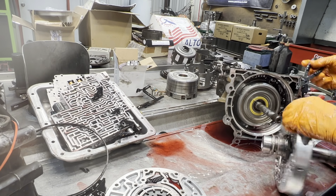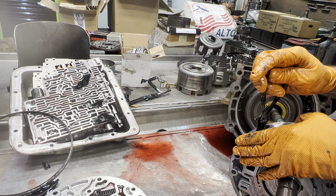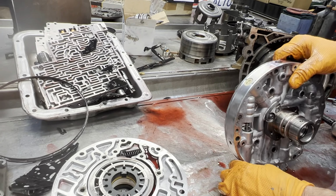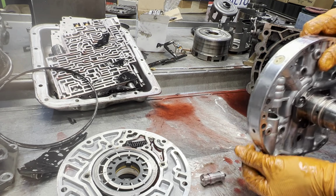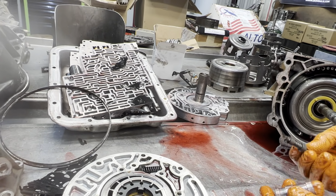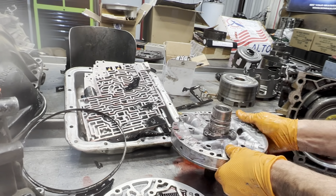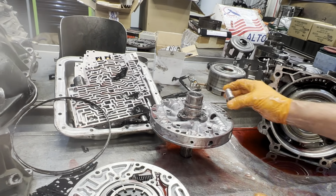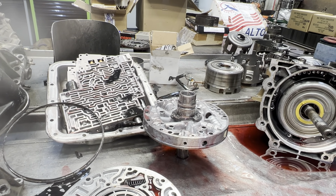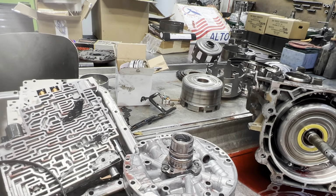See what boost valve we have in this thing. Now this is the early style. Actually, what's crazy, it's got the short boost valve, but it doesn't have the spot for the wiring harness to come through for the reluctor or anything like that, but it does have the short boost valve. Let me look at this real quick, just to verify. Yeah, see? This is a factory one too, short.